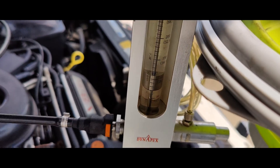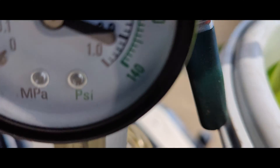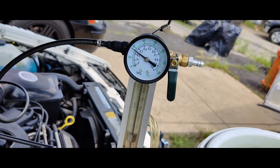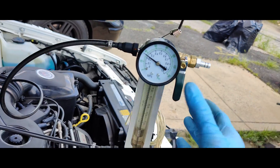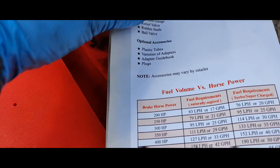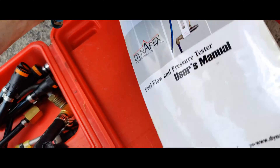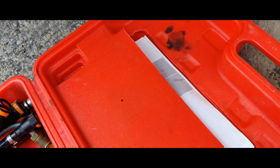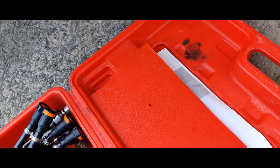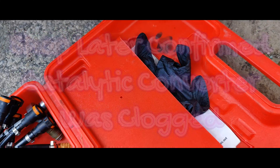If I open this — look at that, we got about 20 gallons an hour, and our pressure didn't drop much. So according to our chart, 200 horsepower should need 17 gallons an hour — so we should be pretty good on fuel. They're going to order a cat for this and drop the exhaust to see. I told them it could be a muffler, but that's a rare chance. I can't do that out here in the street. So that's where we're at — hope you guys liked it, see you later.